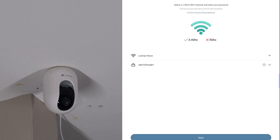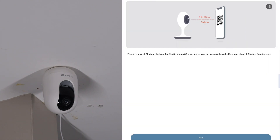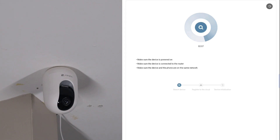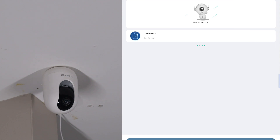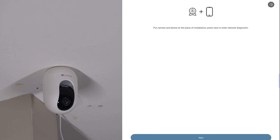Pull the camera up and you'll see the reset button inside — click that and it'll make a little 'yoo-hoo' sound. Then in the app enter your Wi-Fi password. Make sure you're on 2.4 gigahertz — if you have a mesh network router like mine it'll switch over to 2.4 if needed. The app will say: remove all film from the lens, then tap next to show a QR code and let your device scan it, keeping your phone five to eight inches from the lens. Hit next, it shows the QR code, the camera reads it, you'll hear the sound again — and it's connected just like that.